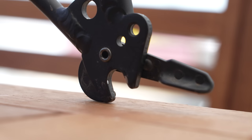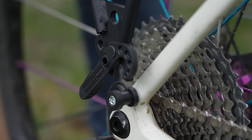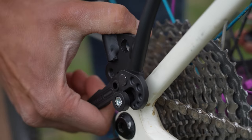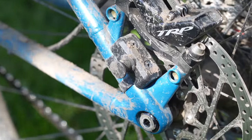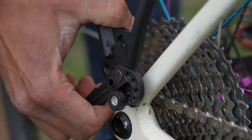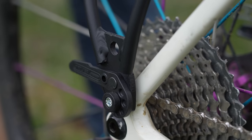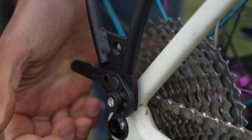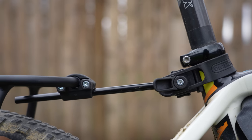The rack comes with a U-shaped cutout and levers that are riveted at the rear dropout of the rack. These fit into provided pegs that thread into rear rack mounts on your bike. If your bike does not have those mounts, the rack will also work with their seat stay adapters, available for an additional 30 USD. After positioning the rack on the pegs, you push up on the riveted lever to lock into place — it snaps in and feels very solid.